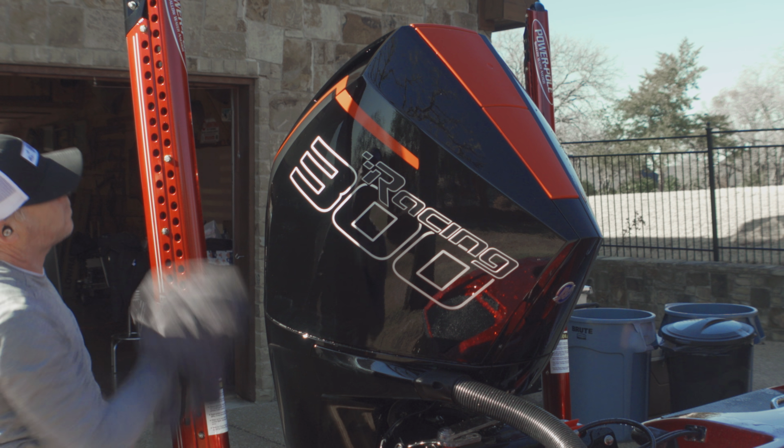So this is probably what I was most excited for. This was my first time to use my new Rupes DA Mark III. It's a Bigfoot with a 15 millimeter throw on it, and it was so awesome, and I paired that with a 6-inch Rupes yellow fine polishing foam pad. And the polish I used is really good for this because the boat was so clean, no defects on it.